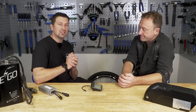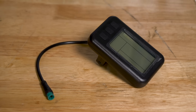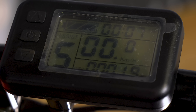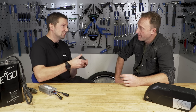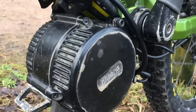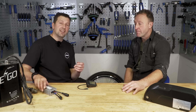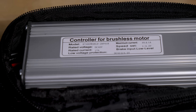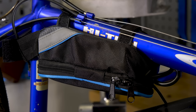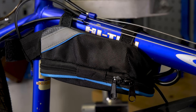We've looked at motors and batteries — what about the other parts? You're going to find an LCD unit, which mounts on your handlebars and displays your speed, power mode, and remaining battery range. The Bafang BBS01 kit, for example, has nine power modes switching between 250W, 500W, and 1000W outputs — pretty high-tech for the money. You'll also definitely find a speed controller, which regulates the motor's speed and is the absolute brains of the bike — it also cuts power to the motor when you're braking.